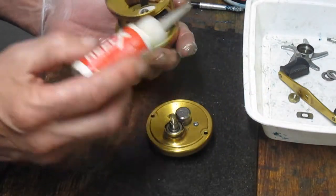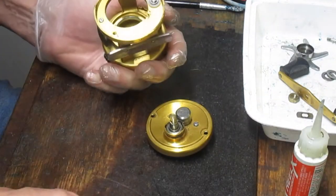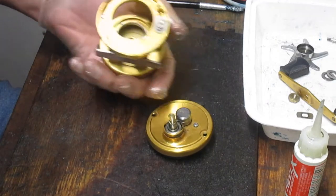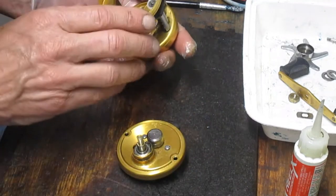If those checks are all okay — and they are — all you really need to do is put a drop of oil into the bearing. You do not need to put any lubrication onto the plastic idler gear. That's a petroleum product by nature and they don't require anything — they're self-lubricating. So that side is done.